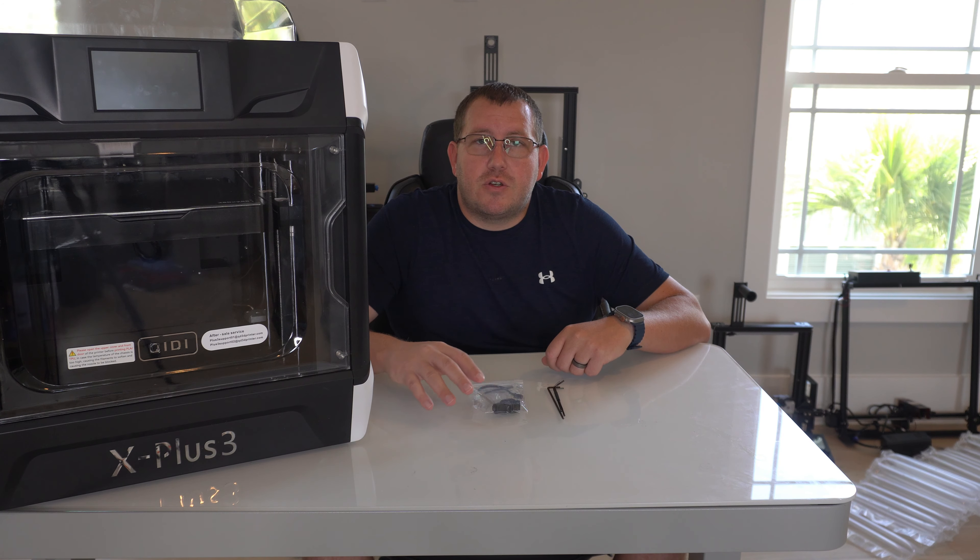So let's go ahead and just take out these two screws. It's kind of hanging down there. Then we'll go over to the back and remove the cover and detach the two cables for the thermistor and the heating element. Now that we got those two main screws off, there's a screw right here that we got to take off as well. Then you can kind of just wiggle this down until it pops out.